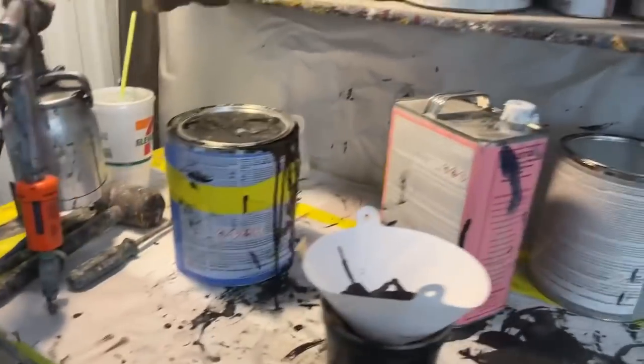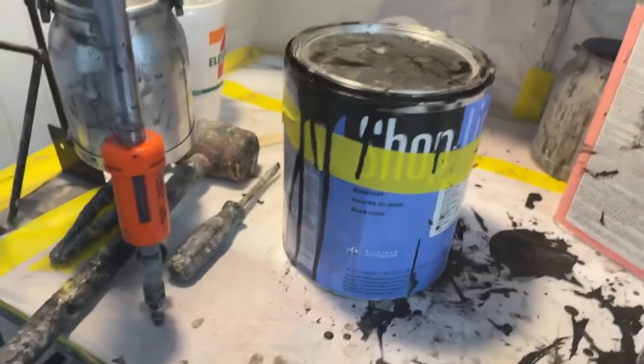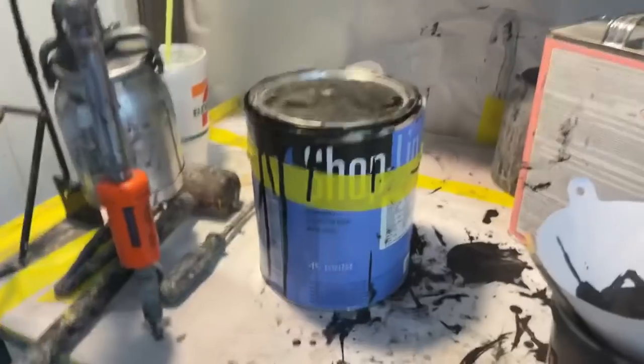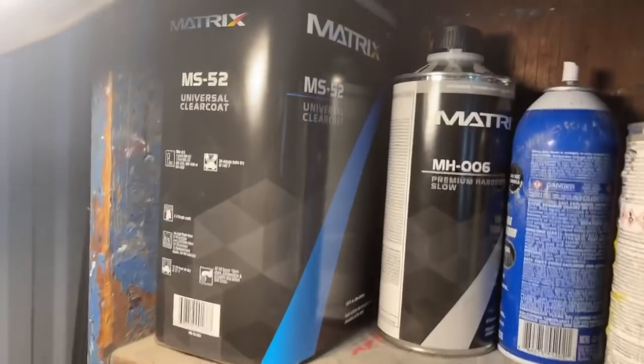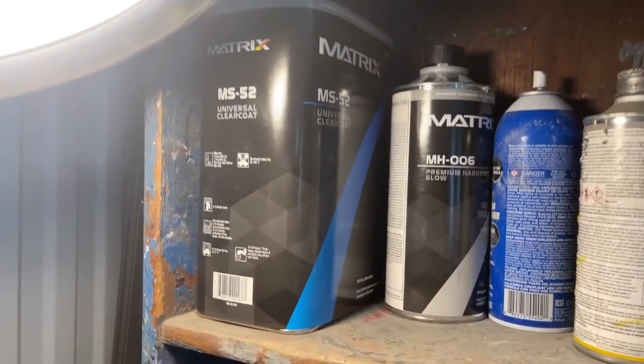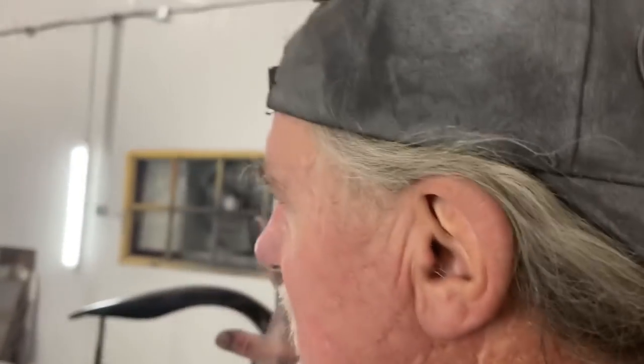This isn't really that professional, but what we're using on this is a base coat clear coat system. I'm using Shop Line base coat paint, and then medium reducer right here. And then to finish it off we're going to go ahead and use Matrix MS-52. Then we're going to go ahead and color sand and buff. There's another step that's very very important if you are looking for a super high-tech awesome clear job — it's almost triple the work but it's way worth it — and what we're going to do is double clear this, and I'm going to show you the trick to doing that.